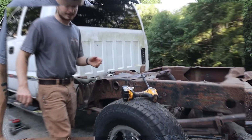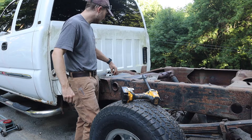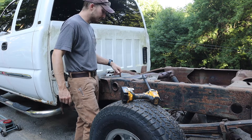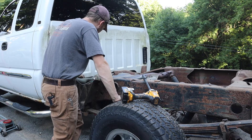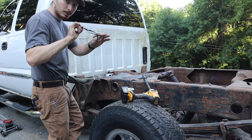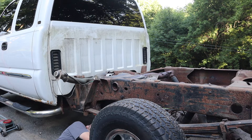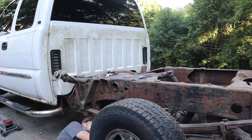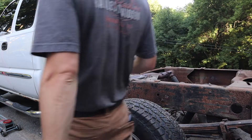All right, so we're back. First thing we're going to do is drop this fuel tank. I already disconnected the fuel lines — pretty easy, they're just quick connect, you just squeeze them and they come on and off. The tank is pretty close to empty, at least that's what the gauge says. The fuel pump is brand new, so that's nice. I think it's a 15 millimeter. I'm going to put my earplugs in and get some PB Blaster — should have done this yesterday.